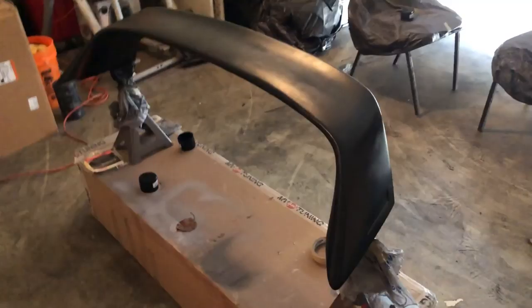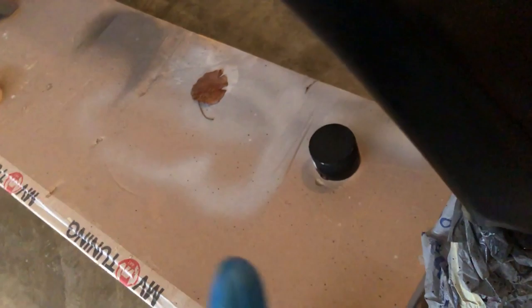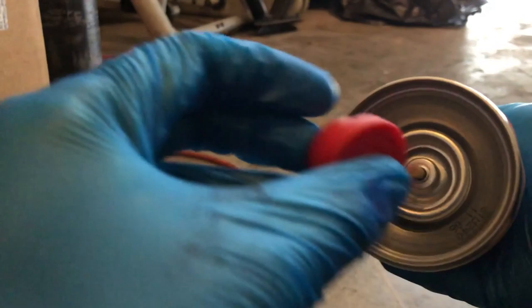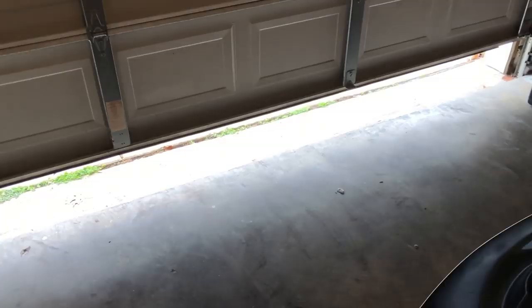Here's the fourth coat and it's looking pretty good, still a little wet. It's pretty dry now so I'm gonna hit it with tack and then spray it with the 2K clear coat. Here's the rear lip - there's kind of a little imperfection here but I think the clear coat should fix it. It looks good from far away at least. This time I will mix it all the way - the red cap goes in there - and then shake it for two minutes.